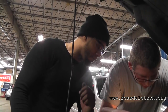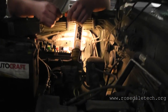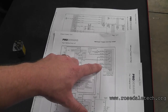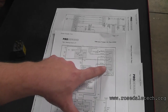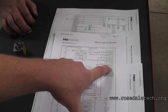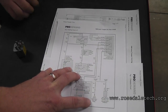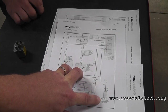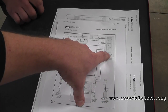This isn't completely necessary that we look at the wires. Let's look at the wiring diagram real quick. This is going to be difficult because we can't get into the internals to know what's what. I'd love to know my wire color but unfortunately I don't. So we have to look at the diagram and follow powers, follow grounds. Looking at the coil — a coil of wire needs power and ground. One side's going to be power, one side's ground.